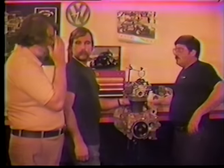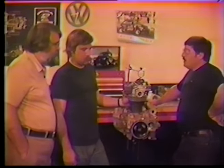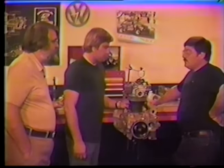People must check piston-to-valve clearance — they absolutely must. It can ruin a hundred dollars worth of stainless steel valves, or four hundred dollars worth of titanium valves, waste a lot of time, and cause you to miss the race.